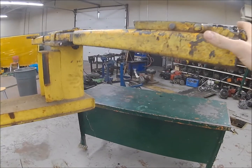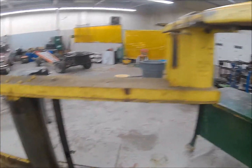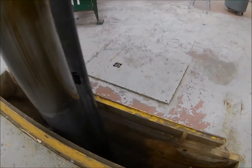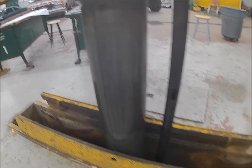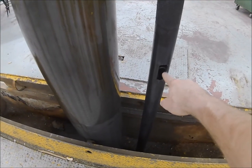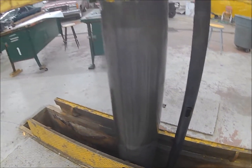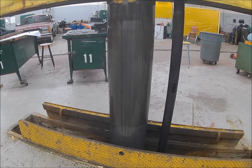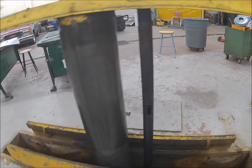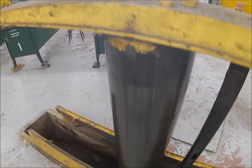Once the cylinder goes up, that's about as high as it goes. These arms and turntables are probably just shy of six feet. In this little hole there is a safety bar with a little tab that flips down — it's supposed to be a safety catch at full height. However, this little tab doesn't always work. I don't use this with my students anymore unless we're in a real pinch, maybe a tire rotation where kids are not actually going underneath the vehicle.